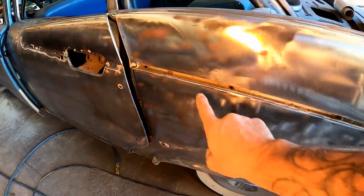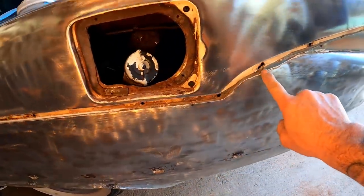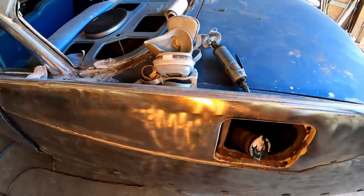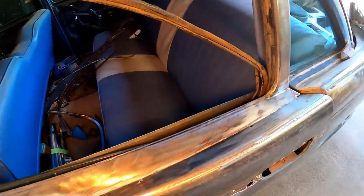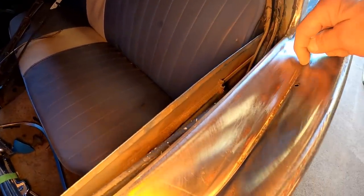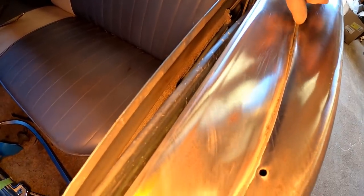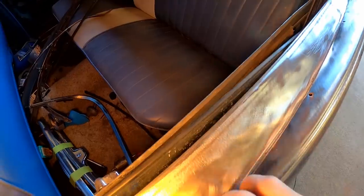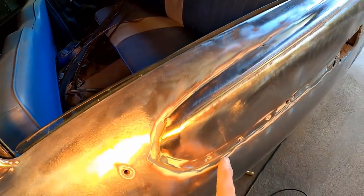You can see here all the way down the whole quarter panel. This is where the fin actually attaches right here. It just kind of goes on its own separate piece. Kind of cool, but it does cause problems for someone that's wanting to do some repainting, because I got to get in there and clean where these two pieces come together. There's actually a gap there. I got to clean all of that out, and we'll have to seam seal all of that. We don't want water just running through there. So we'll seam seal that stuff, clean out all the old paint around the edges.